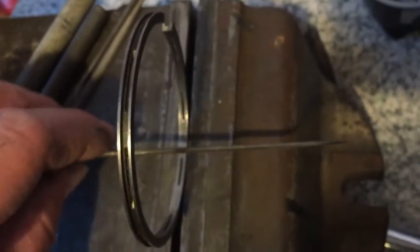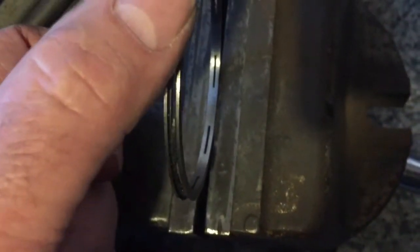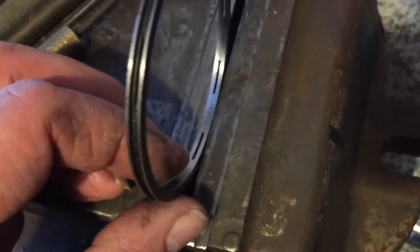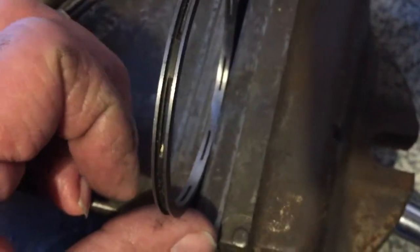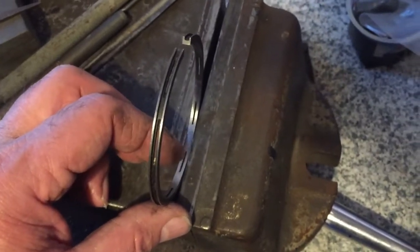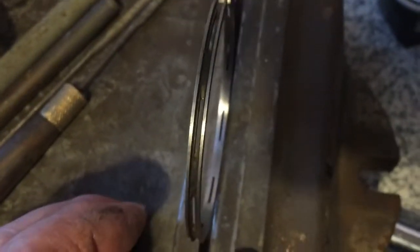One note that I didn't mention earlier, if anybody's concerned: when we fettle these rings, we draw file them, and then I have oil stones, and so I finish off with an oil stone. But it was my concern that I wouldn't be able to keep that face true and parallel with this outer face. But again, because of being able to measure the sweep through with the dial gauge, you can keep these remarkably true, and using it here, just by supporting it with my finger and working here against the parallel jaws of this vise, it's surprising how true you can keep it. And then you can just finish off by checking how true it is across and parallel with the outer face, and just dress it accordingly. But amazing how square it starts off before you do a finishing dress.